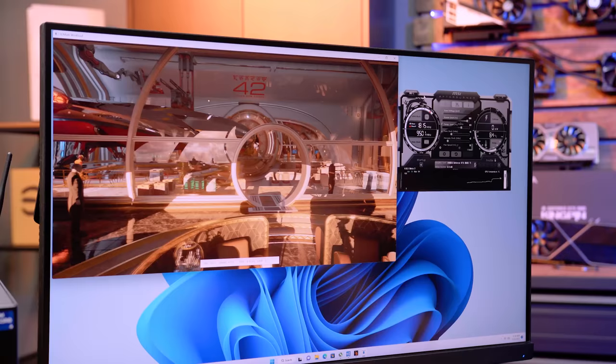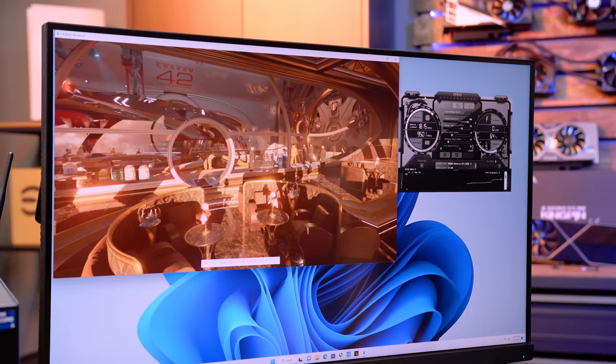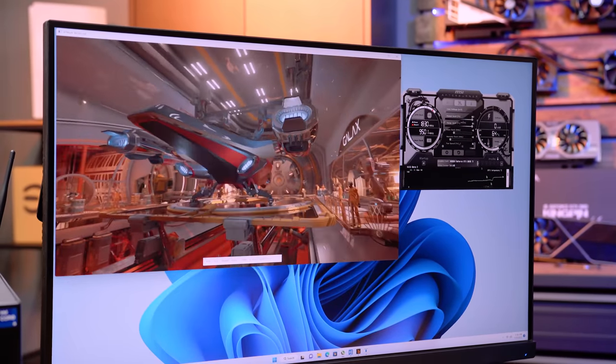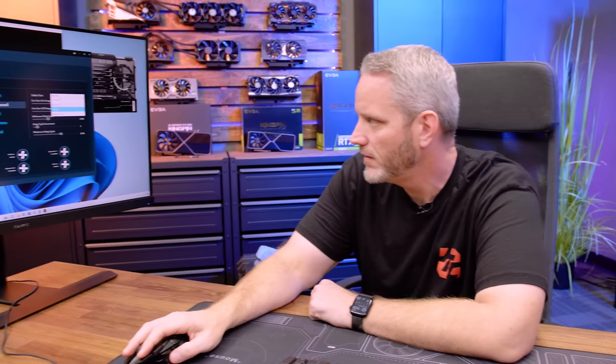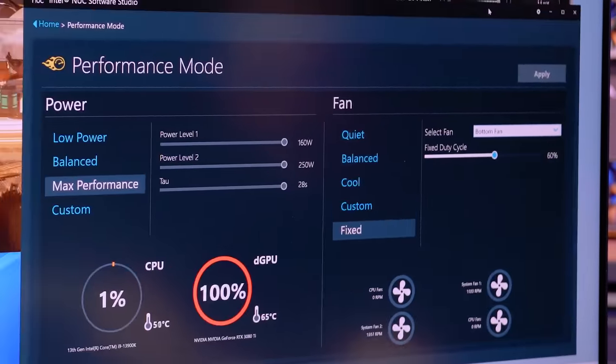I'm impressed so far — GPU is at 64°C. I've been looking at 3000 MHz clock speeds so long that 1800 MHz for the GPU seems broken, but that's where the 3080 Ti boosts to out of the box. Maxing out the power limit and the GPU fans are at 80% fan speed — it's at 65°C in this chassis. It makes sense; it's one big vented box. Taking the bottom fan up to 60% fixed: turning it up will have an effect over time. If we'd had that fan on from the beginning, it probably would have settled around 60–62°C.